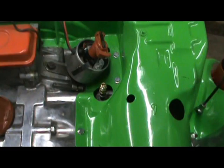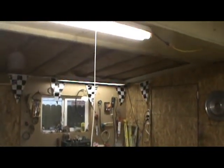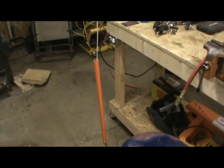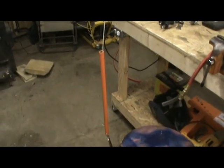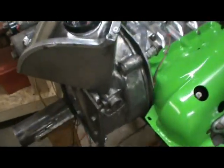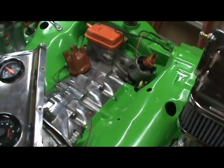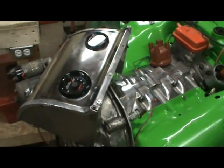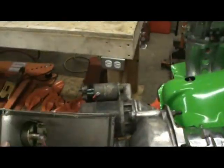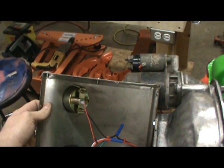All right guys, I got that all plumbed into the block there. Now what I've got to do — I took the hose that they send with the kit and it was all coiled up. If you guys have ever messed with this, you know how hard it is to manage. So I just took my jack handle and a pair of vice grips and hung this thing up last night from the track on my garage door to straighten it out, because when I run it from under here and up along with these, I didn't want it going nuts on me. So I just hung it up to straighten it out and it seems to have worked. I'm going to go ahead and get the oil pressure line ran, get it fit up into the end of the back of the gauge, and get wire ties on it to tie it down.